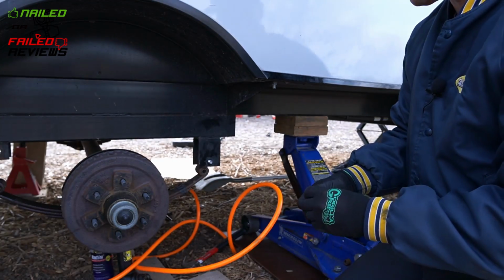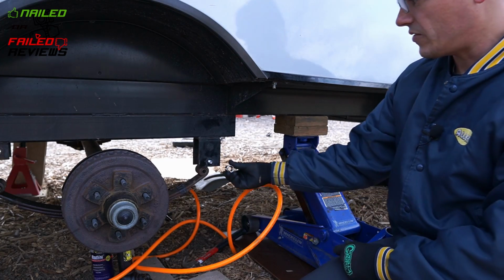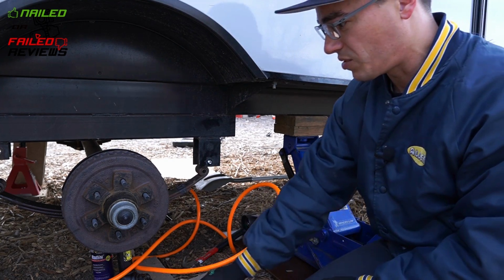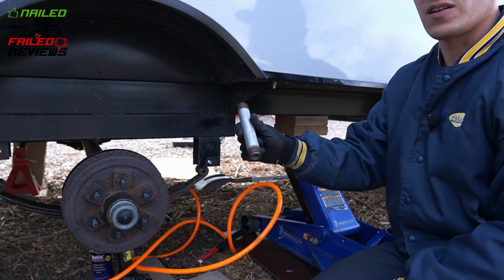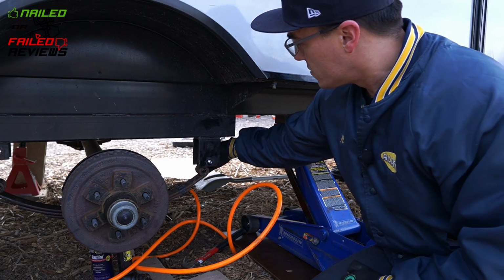A little 14 millimeter, that again we'll put over the Zerk, and then on this side we'll use the 11/16 to capture, to let that bolt come all the way through. We'll put the C-clamp on it, and luckily my C-clamp has a little handle that I can put this little pipe on, because you're definitely gonna need that.